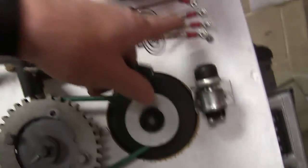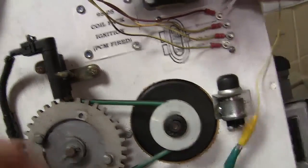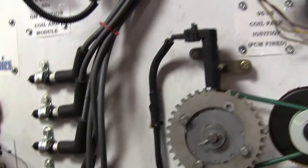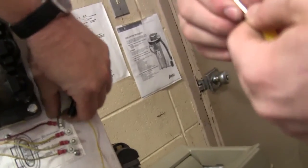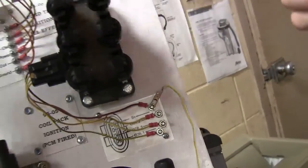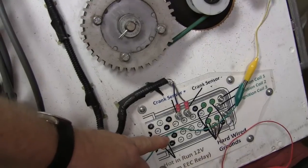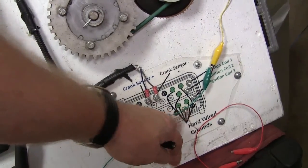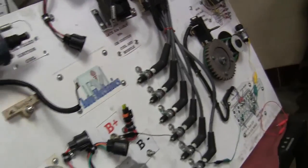See coil 1, 2, and 3 — coil 1, 2, and 3. Put them in that order. You're going to put 12 volts right here and a ground right there. Don't let these wires touch each other because if you do, you may have destroyed something. When you get through with that, we're going to watch that fire. You've got good power there, but you've got to have a ground here — you've got no ground. Put a ground there and it'll work.